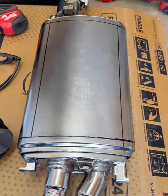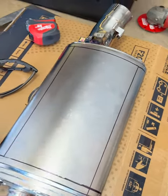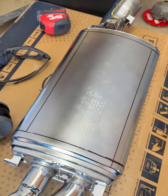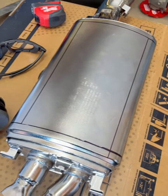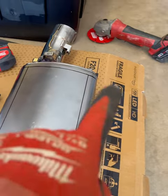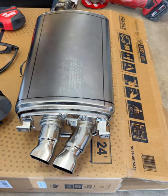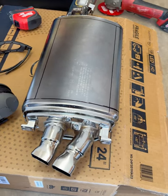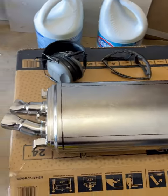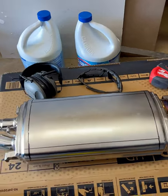We want to see if there's a significant change in sound. This is the back side of the slip-on — I imagine we'll be able to see the weld patch, but this is just an experiment. I have my lines marked that I'm going to cut with my grinder. First it's going to be cut open, then remove whatever baffling I decide to, then weld it back together and hopefully it'll turn out good. This is the start of it — I'll send another video as we proceed.